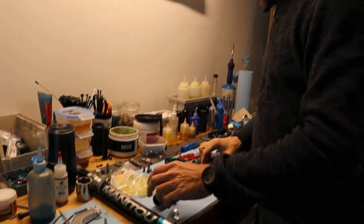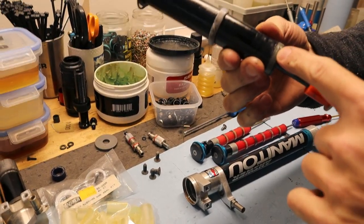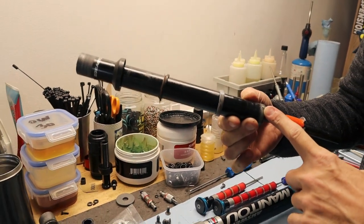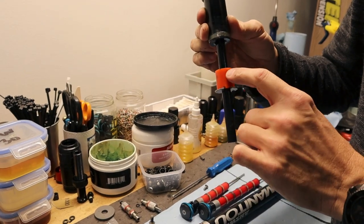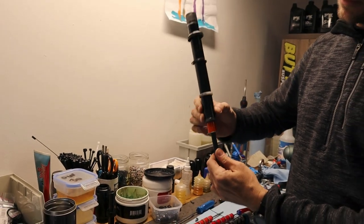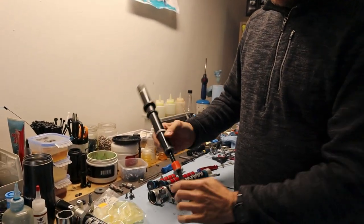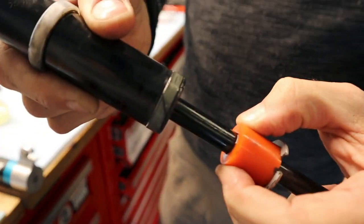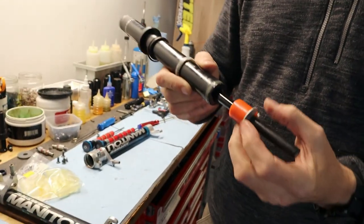And you can see on this upper leg, that's the upper bushing and the lower bushing. They're just plastic. These have virtually no wear, so they're in pretty good shape. This is your bottom out bumper. So this is the rod that pushes up on the internal spring, but this is the bottom out bumper. So when you use all 60 of your millimeters of travel, but you can see this one is still pretty good. But also, it's old, so we're gonna replace it.